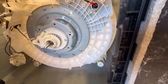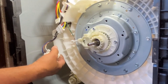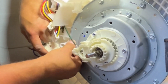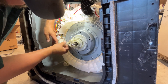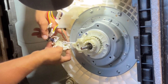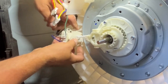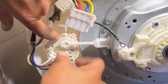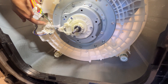Now I'll reinstall the wire harness guard, then reinstall the actuator motor. First I'll hook the actuator arm to the motor — you'll see how it fits in there. You have to turn the motor a little bit to get it to clip through. Tilt it and get it into position, then there's a little pin that it goes into once you get it into the right spot. Then put the screws back in.